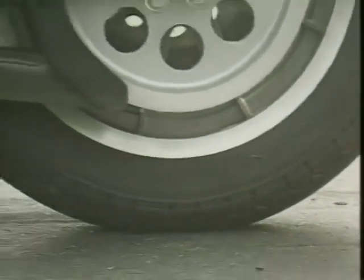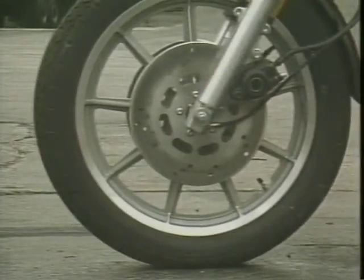Have you ever wondered about the tire tread? The tread design can be a major factor in tire traction. Therefore, the tread must travel in the correct direction to be effective. And tires must travel in the proper direction because of the different loads they encounter. For example, the rear tire is specifically constructed to take the weight and force of acceleration. And the front tire must endure the increased loads of braking.